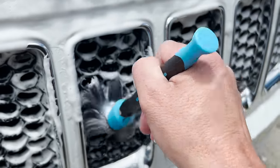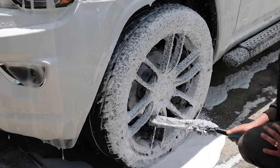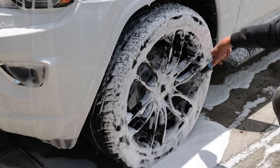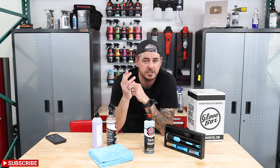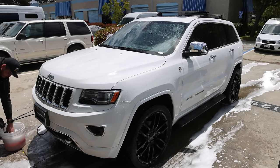While the product is sitting on the paint after foaming on, let it dwell to give it an opportunity to break down the contamination. While waiting, I go ahead and address the wheels — just get into the barrels and use a brush to get back in there. All products and tools will be linked down in the description below. After about five minutes, one important thing to know: you don't want the stuff to dry onto the surface, so make sure you're using it in a shaded area. The weather for me was cooler and overcast, so the paint stayed very cool to the touch. Foam it on, let it dwell, rinse it off, and you're good to go.